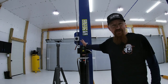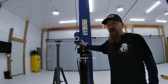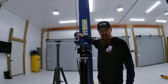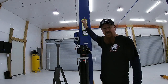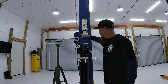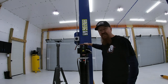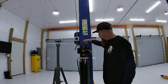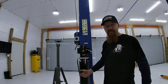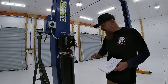In terms of wiring, it's a very simple system. You're running 220V — the installation manual says you need a 25-amp breaker. I ran 10-2 wire in a shielded cable for protection. I had wired up a box in my ceiling before insulation went up, ran it down the post. I also wanted an outlet for my welder, and since I won't be welding at the same time the pump is running, I split the wire and put my outlet in before running it into the box.